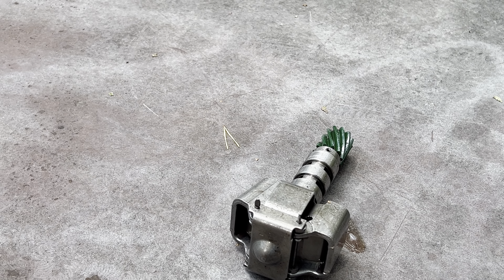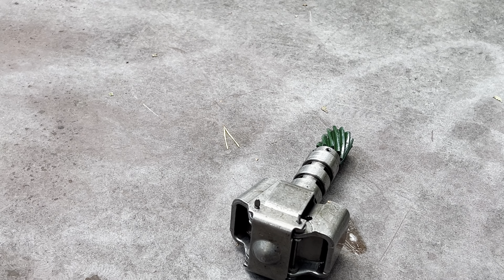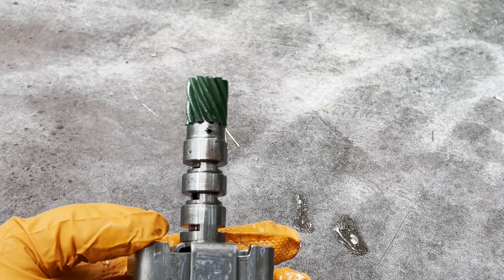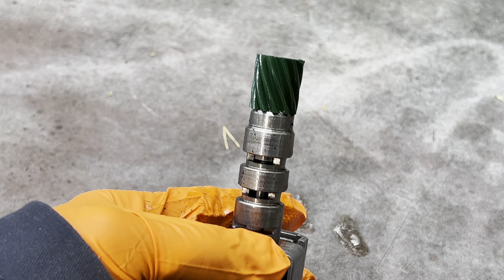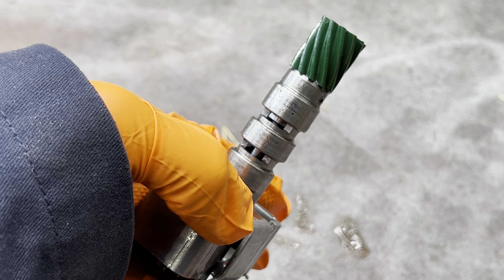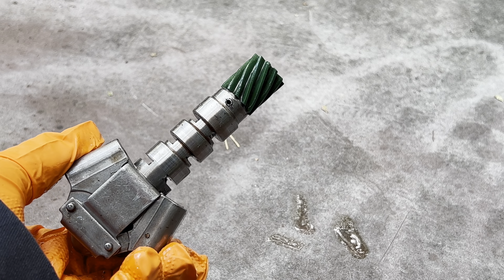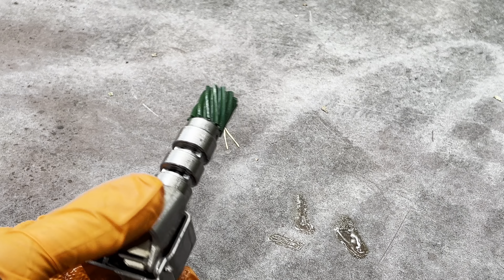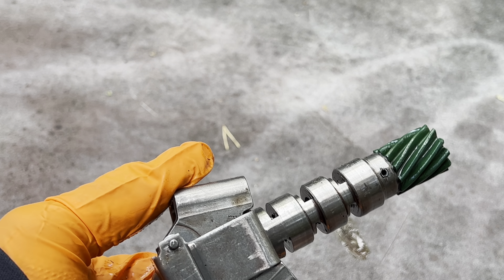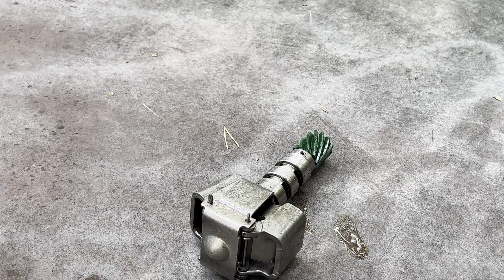That's the reason I bought a new one and put it in, and now I can drive the car and it's doing what it's supposed to do. But I don't recommend them to nobody. Like I said, this governor gear is fairly easy to get out. If it's not functioning, if it's not moving, this could be the problem why your transmission isn't shifting. This is what it looks like — if yours isn't working and you want a new one, I've seen them for about $95. Some may be cheaper, some more expensive, but around $95.